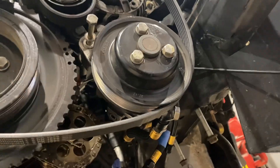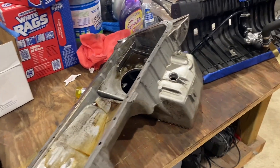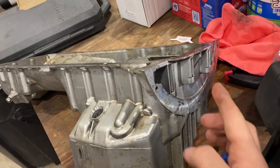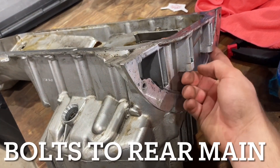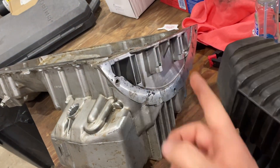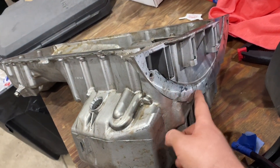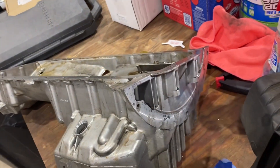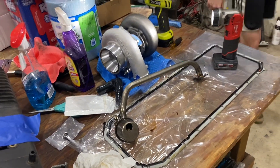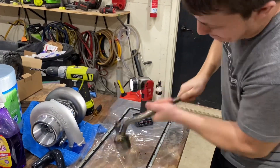The pan is now out. You need way less bolts than you think to remove it — take out your dipstick, and then you've got to take out two torx bolts here and here, and there are also E-torx bolts going from the bell housing. These two are just 10mm — oh, those are tens, sorry. The other ones I think are E11 E-torx — there's one over there and one over there. We also found some plastic in the pickup tube, and Cody was just shaking it trying to get it out — pretty funny.